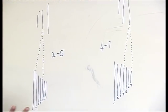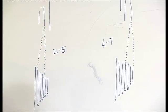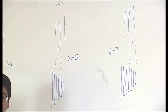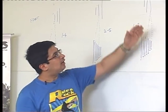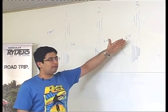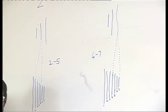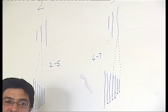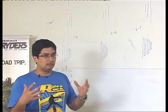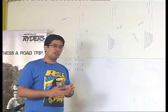These ranges show that if you go beyond them, there's a possibility of the chain becoming entangled or coming out of the chain wheel. For instance, if your front derailleur is at number three gear and your rear derailleur is at number one, that's a really wide angle for the chain to handle, creating a lot of tension. The chain may break or get entangled, which is why we recommend these gear ratios.